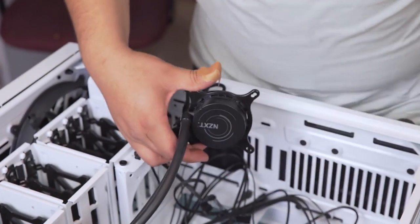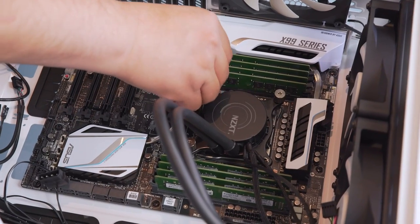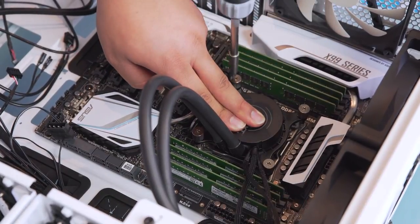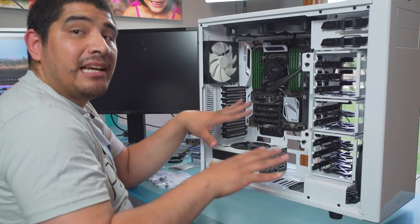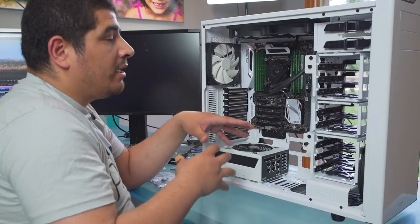There seems to be a lot of confusion out there with power supplies when it comes to a high-end computer build like this one. So I asked him what his thought was on a good size for this build. A silver to a gold 750-watt is probably going to entirely take care of you and still give you kind of headroom. So that's going to be okay.